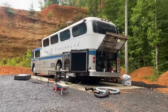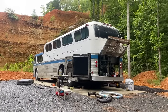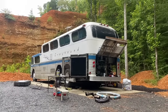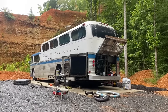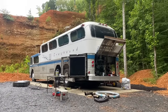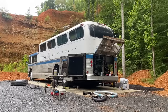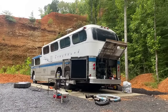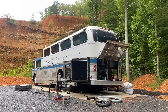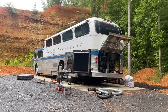The new exhaust pipe came in, so we're getting ready to finish fabbing that up. We'll get rid of that exhaust leak too. Working on the wheel seal. The wheel seal was supposed to get delivered this morning and it hasn't shown up yet. And the voltage regulator was not working. When the alternator was tested without the regulator, it would produce power. So that ended up getting shipped to the wrong zip code. A 3 was changed to an 8 in the zip code on UPS, so we're not sure when that's going to show up now. But we'll get into this wheel seal, do some more adjusting on the brakes, and then we'll get this exhaust back on, and I think he'll be hitting the road sometime tomorrow.